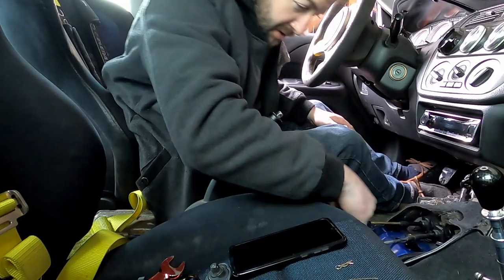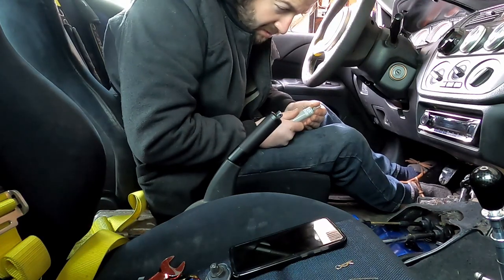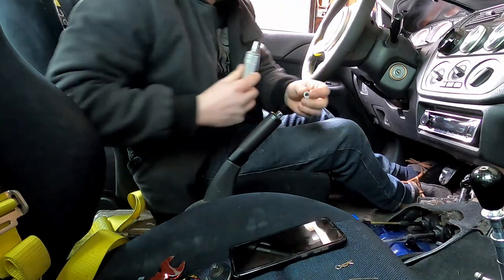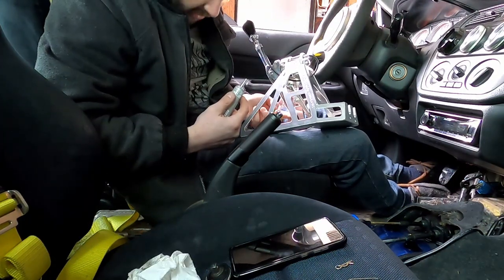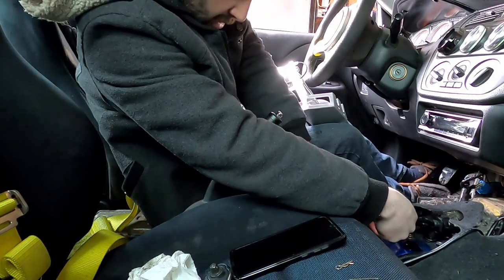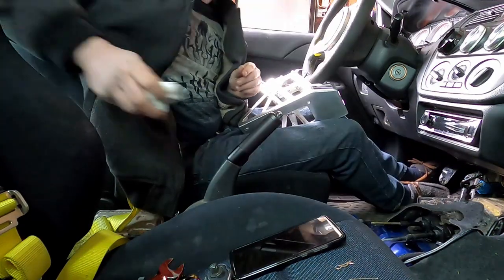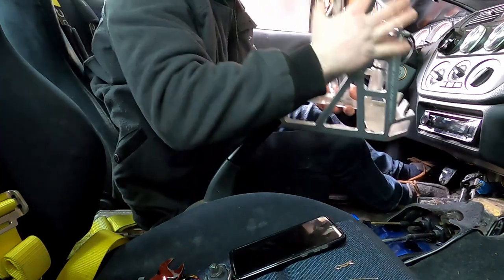Let's put it in. These are moving metal parts, so you definitely want to have a light coating on the ball of the shifter right here. This is just white lithium grease — nothing fancy; you can find it at your auto stores. My suggestion would be to get the old grease out and then put in new grease.